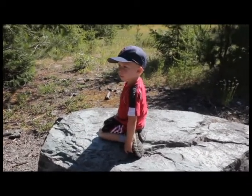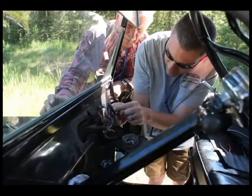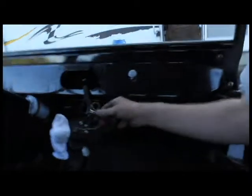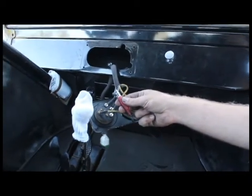Why are we stopped? Because the monkey broke. We were driving down the road and the ignition just cut out completely. We lost all power. When we pulled over, I was able to start it up right away on battery, but wasn't able to turn it to mag. Unfortunately, our car runs off 6 volts, so it runs a lot better off of magneto rather than battery.